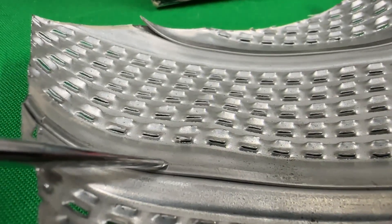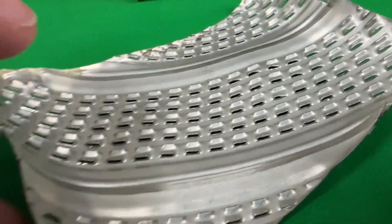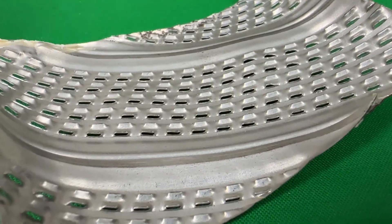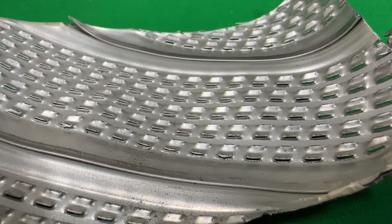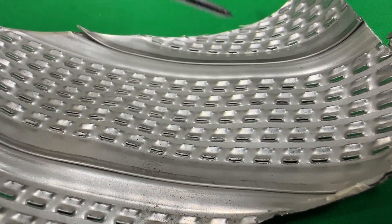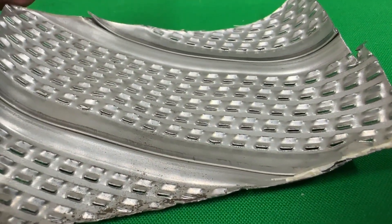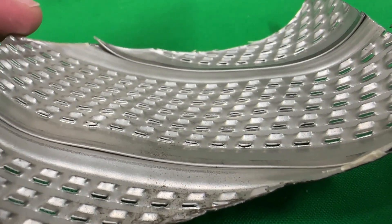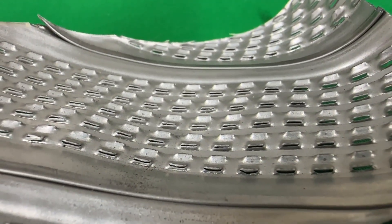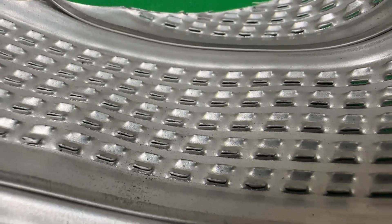That is a poor, poor louver stamping. Wix got it okay in one direction, but spin it 180 degrees and look how they got it on that pass — this thing is like 50% stamped. I don't have time to calculate the surface area of every louver, but I would bet this filter would run at about half the flow rate it is designed for — half the louvers are almost closed. Look how sharp and jagged they look. That's terrible.